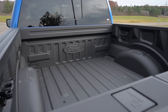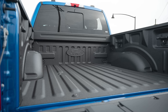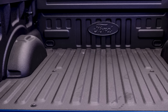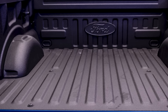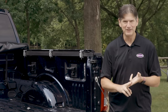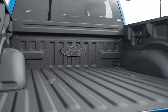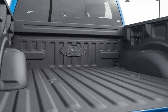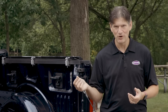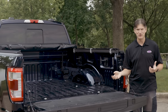And then there's the spray-in type, which is more expensive. Spray-ins are usually the choice of people who want their truck to do hard work because spray-in bed liners are really durable. They are essentially a very strong paint — the surface gets sanded and then it's painted in. They're cleaner, they can't slide around, and the surface prevents cargo from sliding around, but the downside is that the surface is really coarse, like 20-grit sandpaper, so it can also damage your cargo.